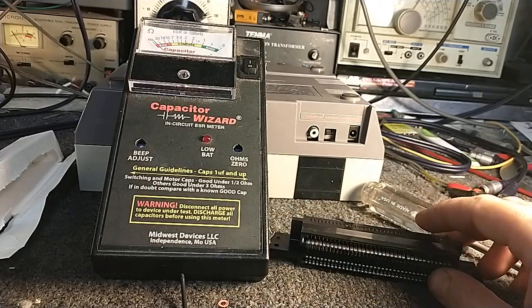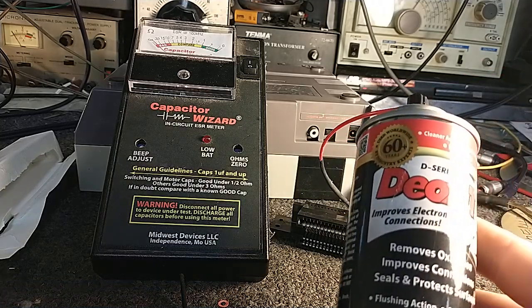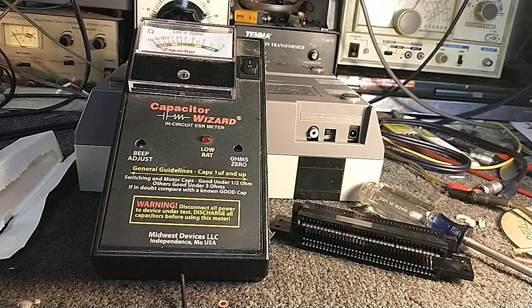To recap: these things wear out. If you're getting tiling, glitching, and you always have to constantly fidget with the cartridge to get it to play, replace the connector. Keep up on your cartridges — clean them using the DeoxIt method with a Q-tip to swab the contacts. Don't use one of those cartridge cleaner tools; they will kill the connector in an accelerated time frame. I've had this NES since it was new, so the fact that it's lasted 35 years is pretty good, but they do wear out. There are tons of videos on YouTube on how to change out that connector — I'm not going to make one because too many already exist. Hope you find this information useful for troubleshooting problems with your NES. Thanks for watching!